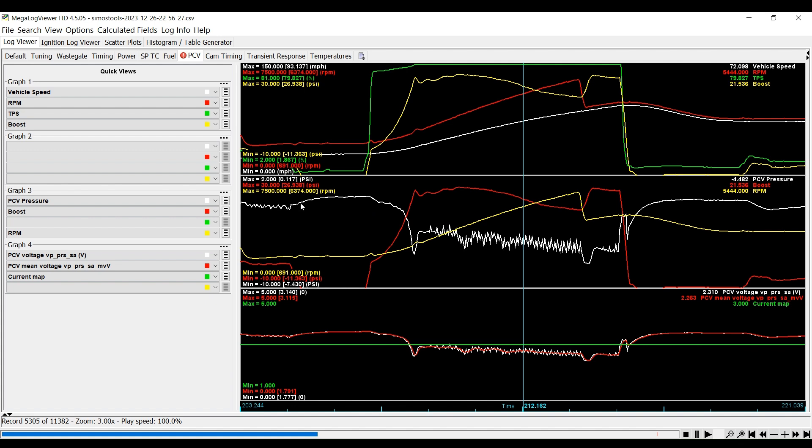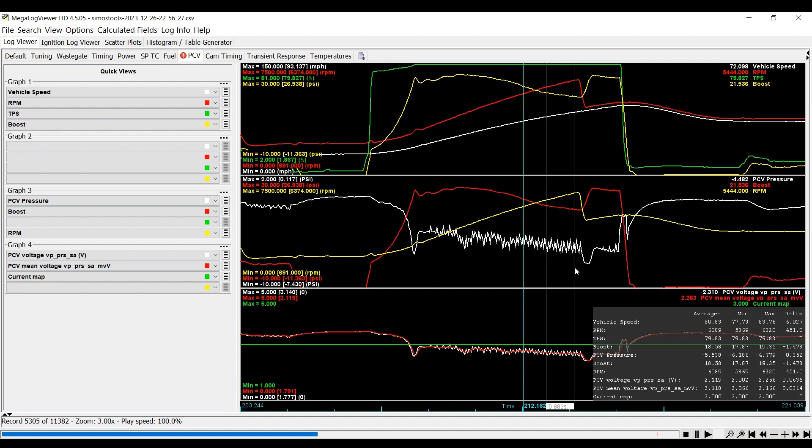Right here is a sample of the data. I haven't had a whole lot of time to really look too deeply or do a whole lot of driving just yet. You see right here is the PCV pressure — it's 2 PSI at the peak up here. The highest I'd ever actually saw was about 0.1 PSI and that was like a little blip, but generally it stays pretty low. The reason why it's all spiky — I found out after doing this initial logging that there's actually a mean voltage PID as well. So I'm going to be changing my pressure reading to go off of that because it's basically a factory smoothed value, which will be more valuable rather than having to interpret these little spikes. But basically at the peak vacuum levels on the higher boost setting, we're looking at a peak of negative 6 PSI, average of about negative 5.5.